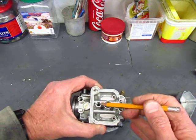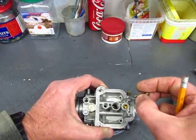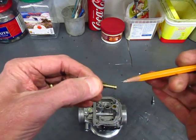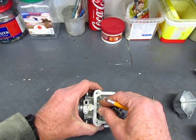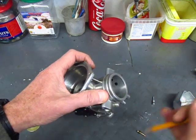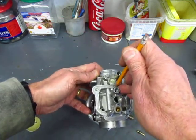So the design of the idle circuit is to take advantage of that little hole and to pull air in through a smaller orifice here — a smaller fuel well. That's the idle fuel well. This is the idle jet that fits in there; it has a little orifice in the top and some smaller holes drilled around the side, and it screws right in there. That hole right where the low pressure is from the engine actually runs through a passage to the fuel well.